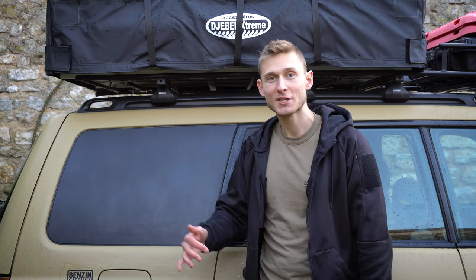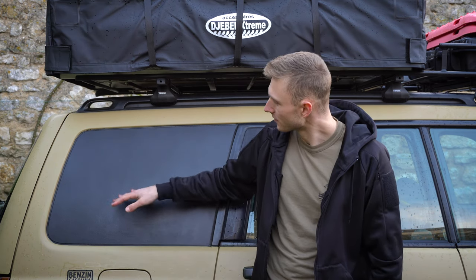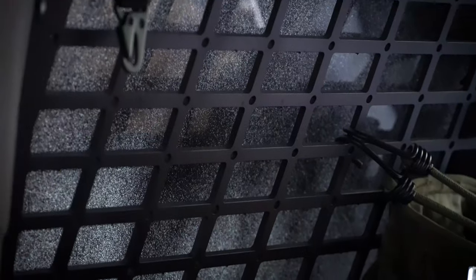After looking from different angles, I love it. It looks pretty cool with a nice texture finish and it's also good for privacy because you can't see anything inside the car. A rookie mistake I made — and you don't want to do it — is to spray too close to the window, because at the end you will have an uneven application with different shades of PlastiDip, with more shiny parts than others. That's not what you want. And something pretty important: it doesn't look good from the inside. Really, you have to know that — on the inside it's really not good.